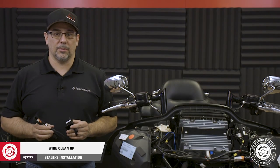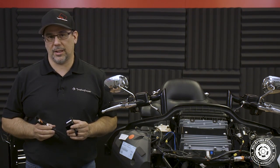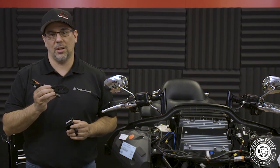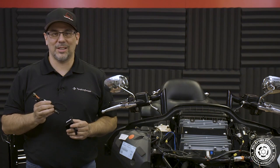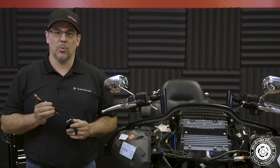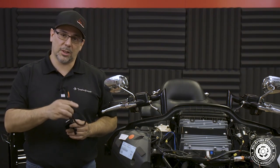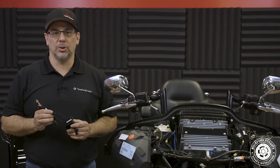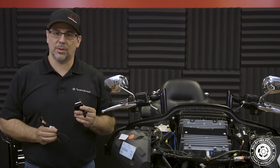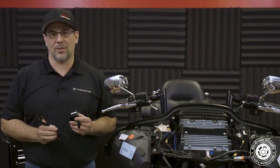Now we're ready to clean up our wiring. You'll likely notice some extra wires on our T-harness and included in the kit. This harness allows you to use our DSR-1 digital signal processor. For more information, download our DSR-1 setup guide for Harley-Davidson and keep an eye out for a complete configuration video we'll be releasing in the future. Since we're not using a DSR-1 on this motorcycle, we'll zip tie the blue wire that's used for the processor. We also include some extra wire adapters and boom audio bypass plugs that are not used on this motorcycle but are covered in other videos.